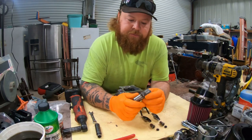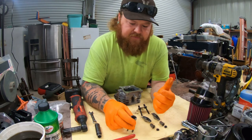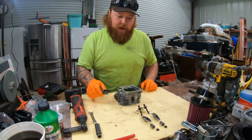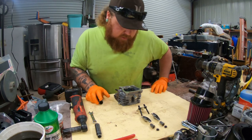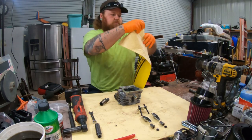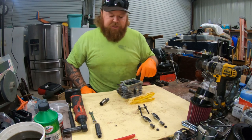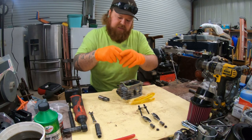I made this little contraption a long time ago when I was doing valves on something. It's just so you can put it on there, push down, and get the keepers out. I'm going to grab a magnet so when I push this down I can use a magnet to pull the keepers, and then the valves will come out. I'm going to put this under it kind of at an angle so when I push down the valves don't try to slide - I want the valves to hit that and the spring to compress.